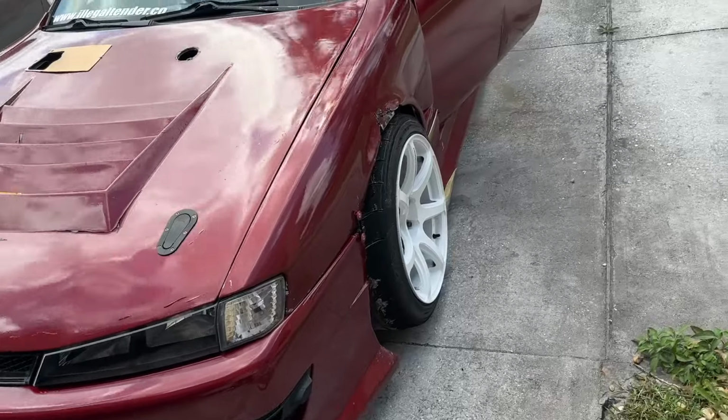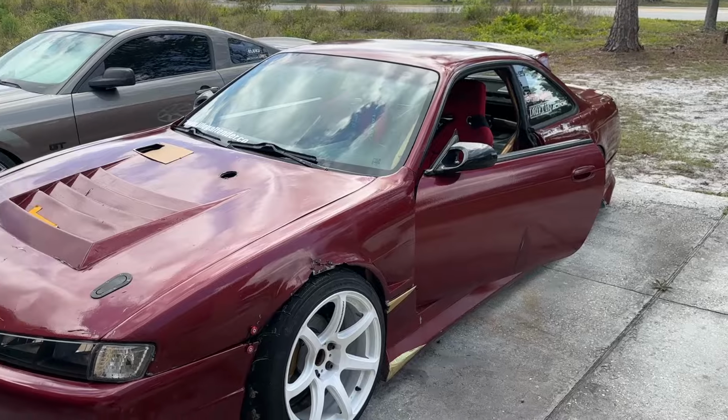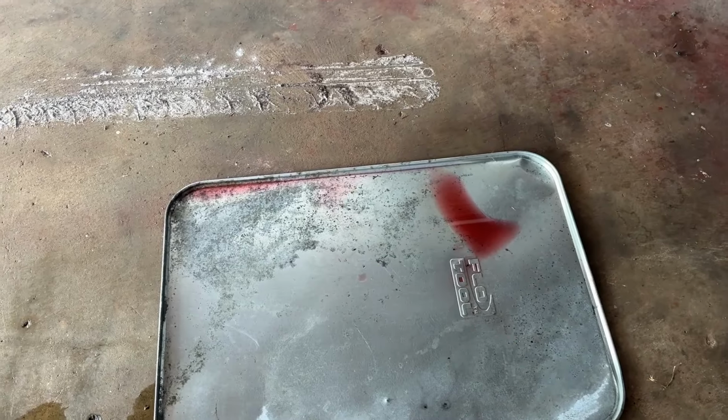Rig looking nice and clean. Finding that idle. I've been fighting a power steering leak for a little bit, and it looked like it went away. I tightened up some lines after I changed the rack, but looks like it's back. That's ATF.